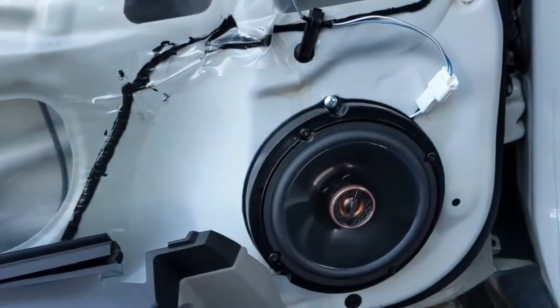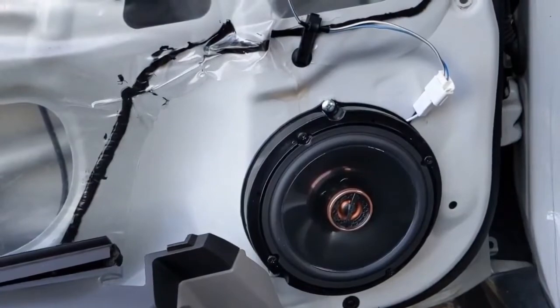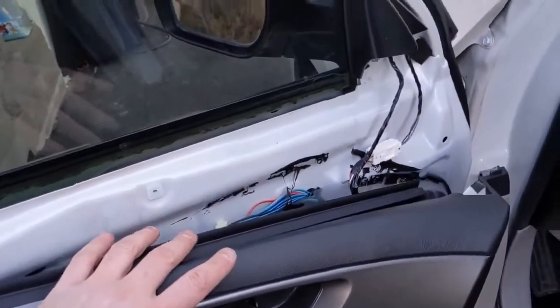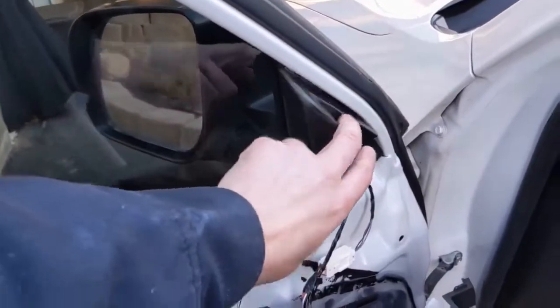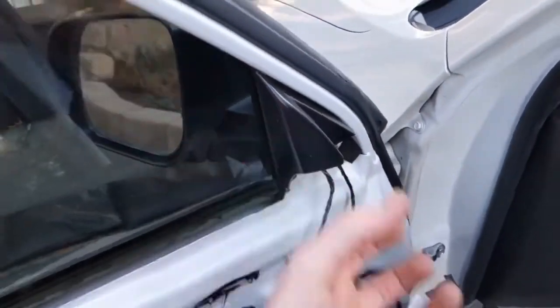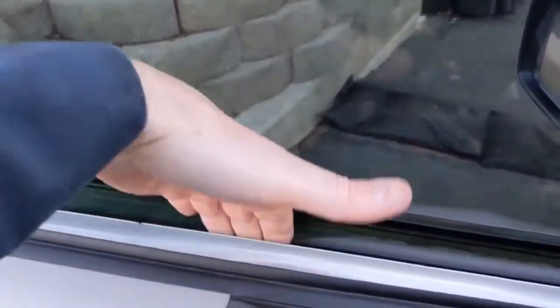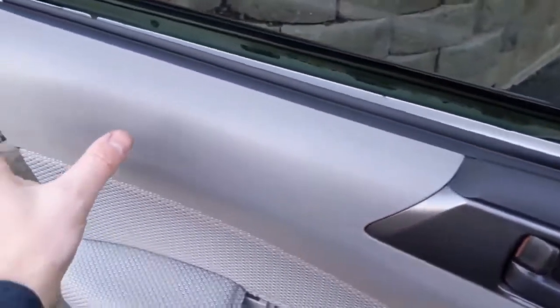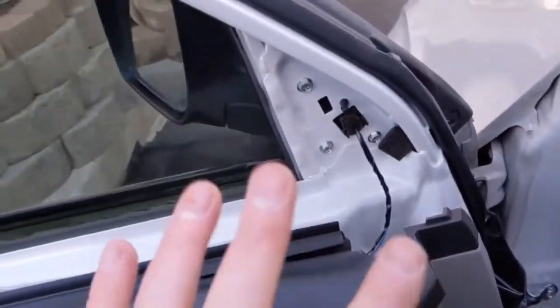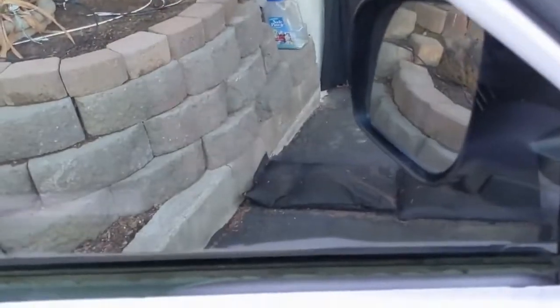This is the driver's side; the passenger side is done the exact same way. The easiest way to put the door panel back on is by removing this little wing piece — there's just one clip inside, so pull on it and it'll come out. The panel goes on the top first, resting in the window slot, then line up where the pins go and push it in to lock everything together.